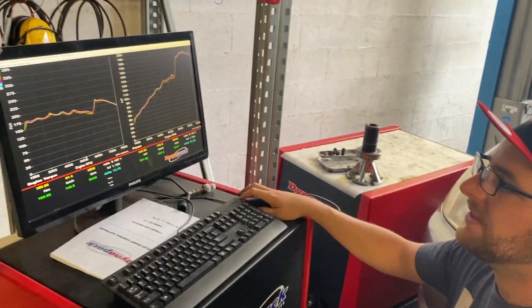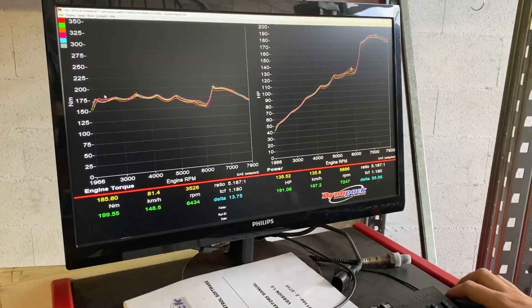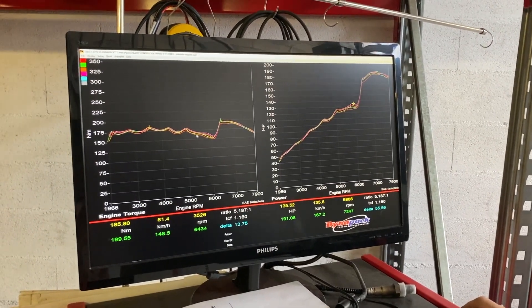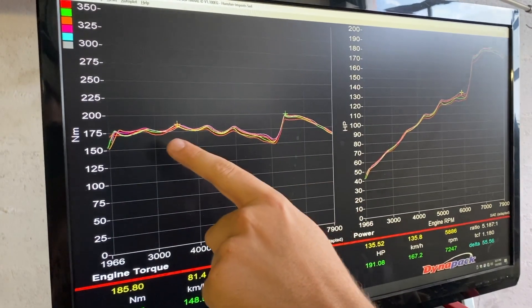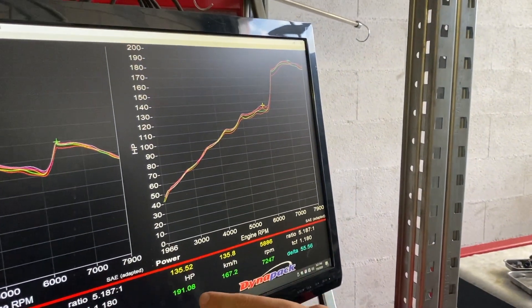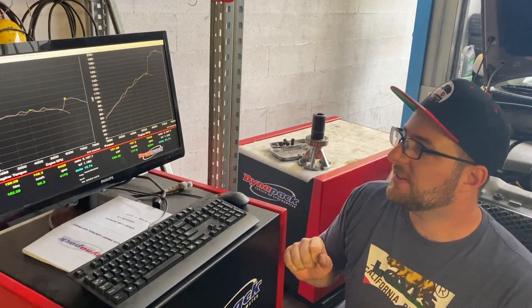We just did six runs with this car. It's not in the best condition but I'm very happy because it's really making the power it should. Looking at the screen, you can see the torque curve in Newton meters and the power curve. Everybody talks about LIFT or VTEC — well, this is the point where it jumps up, and the torque increase is extremely steep. We have roughly 185 Nm before VVTL-i engages and around 200 Nm after. This car is supposed to have 190 horsepower, and with 18% transmission loss accounted for, it's making peak power as announced — after 171,000 kilometers. Toyota, good job.